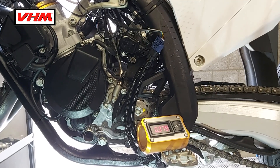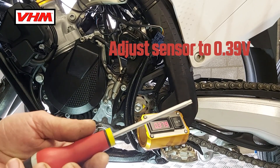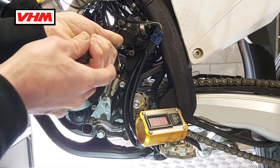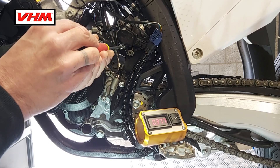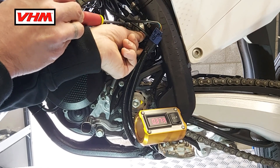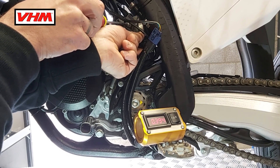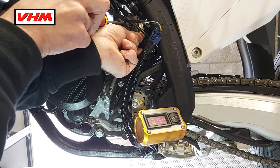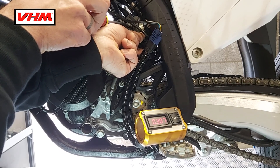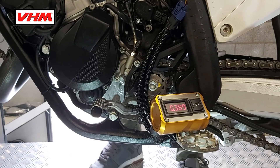As you can see, the sensor is a bit off on our bike, so we're going to adjust it. We use a Torx 25 screwdriver to loosen up the bolts. You can see how sensitive it is — just loosening it up slightly and it already turns a bit. Adjust it to 0.39 volts and maintain that, as it is very sensitive.